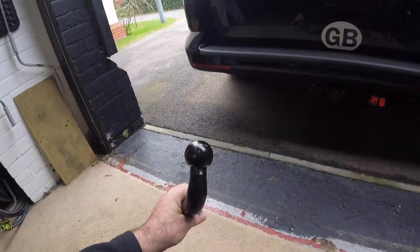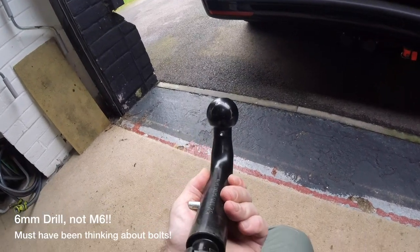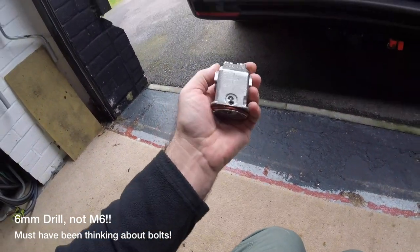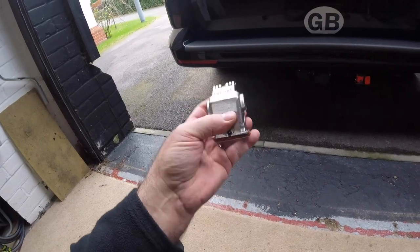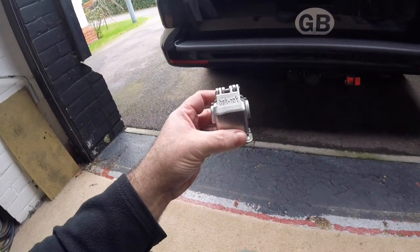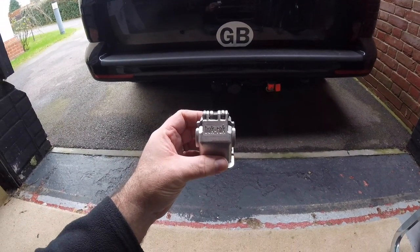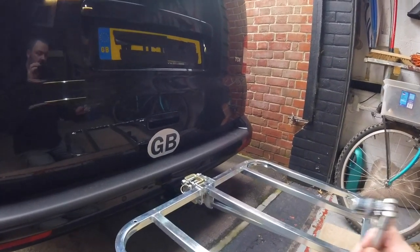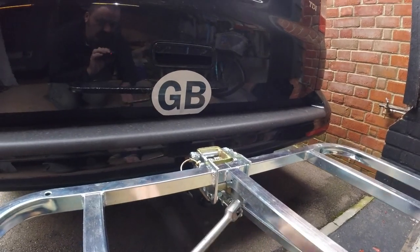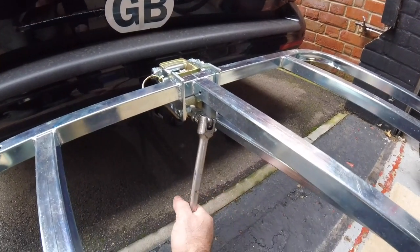Let's go over that again. As you can see, very slight countersink drill — I think I used the tip of an M6 drill — front and back, and then the small grub screw on either side of the clamshell. Once that's fitted you can rotate it and it firmly finds those holes that have been drilled, and I know that it is perfectly square to the back of my vehicle, so when I drop on the back rack and tighten the 19mm bolt the rack is exactly where I want it every time.